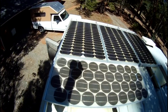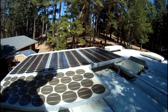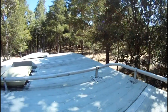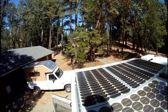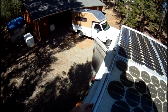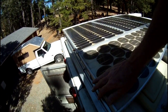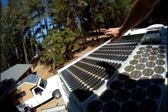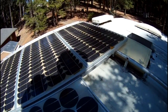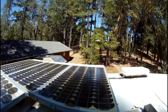I also want to show you how these panels are mounted. Luckily, I already had a luggage rack up here, so I decided to mount the panels to that. What I did was build a framework out of aluminum angle iron, with some bracing, so basically all the panels are bolted together and reinforced with the angle iron to make sure it all holds together and doesn't come loose.